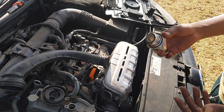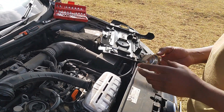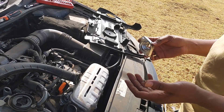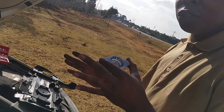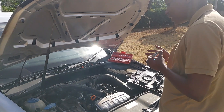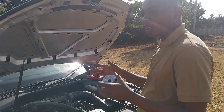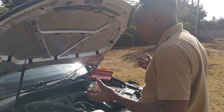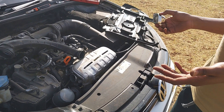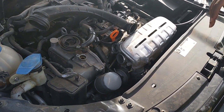What does a dump valve do? A dump valve is a valve — there are two sections in a turbocharger: the high pressure section and the low pressure section. The dump valve diverts air from the high pressure section to the atmosphere, which relieves pressure from the turbocharger. I don't know why manufacturers don't pre-install them, but I would highly recommend them for a turbocharged engine.